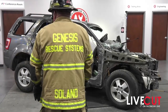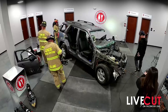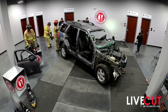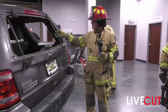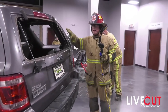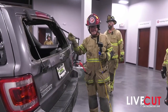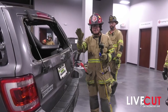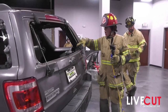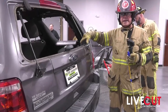Let's talk about hatchbacks. One thing to be very cognizant of — if you have a hatchback, you know that inside those pillars you're going to have at least two gas struts. We don't want to blindly cut through anything. If you have a hatchback where the window lifts up also, you'll have at least three gas struts and sometimes four. If you have to cut the gas struts, don't cut through the mounting hardware. Always cut through the smooth, shiny portion — whether black or silver — and make sure you're always cutting at a right angle.